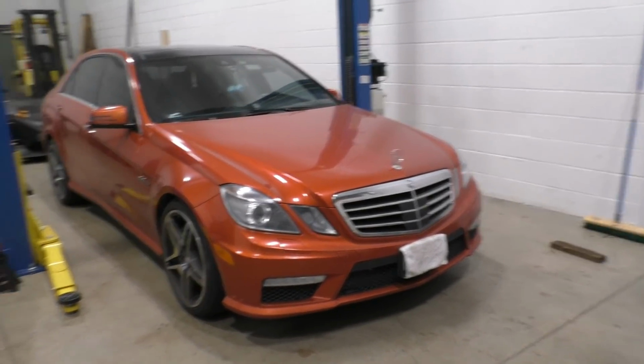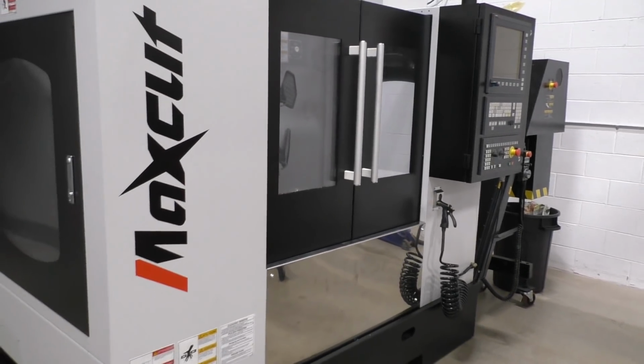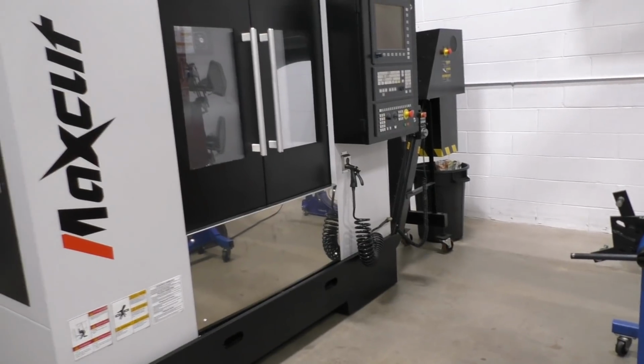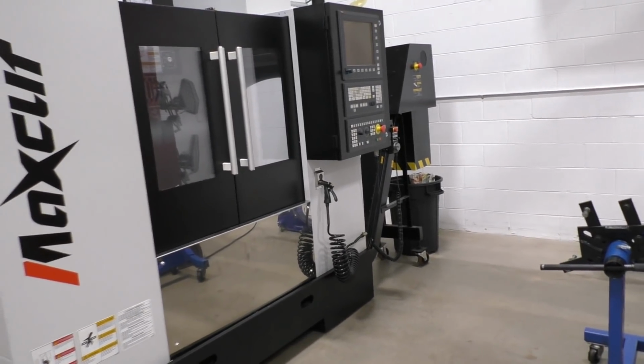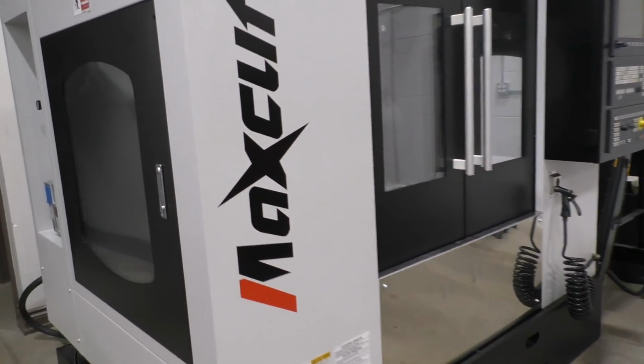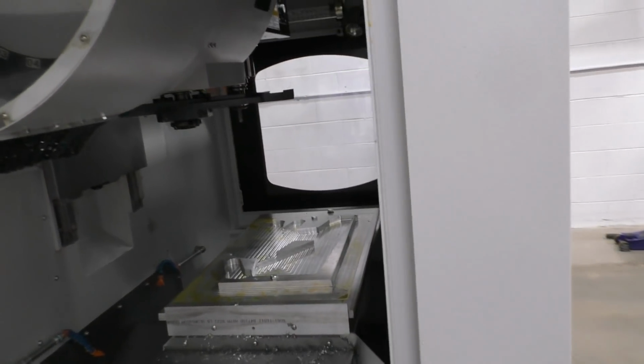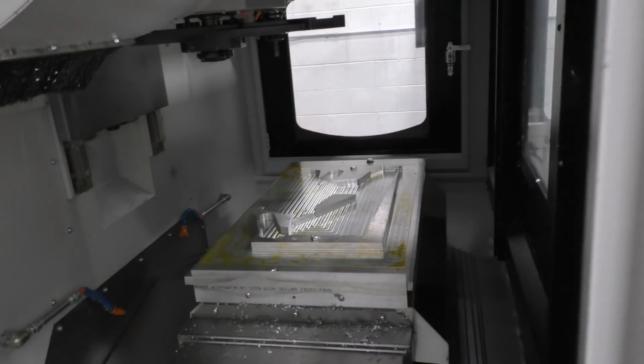But either way, there's going to be quite a bit of content coming up for you guys, because this machine is up and running now. I did have a few problems with the CNC machine initially, like the chip conveyor used to trip the whole machine because it was wired wrong, and the coolant used to blast all over the place, so the flood coolant was pretty much unusable. That's why cutting aluminum is a hassle, because you used to weld the aluminum if you try cutting it without coolant. But now all that is fixed.